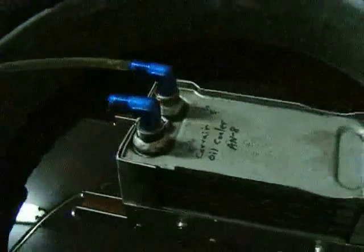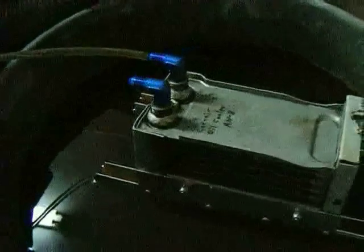If I put some real pressure — pull this line off and squirt compressed air through here — it'll go through and come out, and there are actually chunks in there. The trouble is that the oil cooler is past the filter, so any chunks left in there would inevitably get into a main bearing or something and you'd have a seizure. I don't consider this airworthy — I would never use this in an airplane. That's my personal preference; you do what you want. I'm going to put a different oil cooler on it.